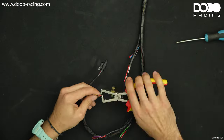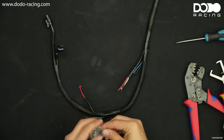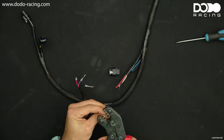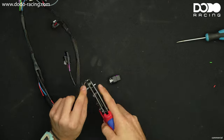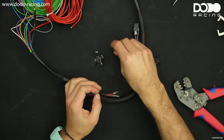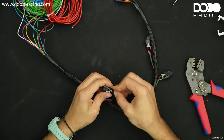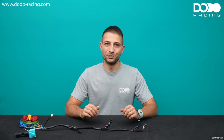All that's left to do now is wire the other five connectors. You can also add some heat shrink, but I like my wires just a little bit exposed — this way I can easily recognize the color code afterwards and it's just a little easier when you want to wire your ECU. Also, if you are running wasted spark I would still recommend pulling all six trigger wires to your ECU. Maybe you want to upgrade later to sequential, and it will be a lot easier if you have all the trigger wires available at your ECU. I hope that you enjoyed watching this video and I really hope I could take away some fear from you, because I think there's nothing more satisfying than holding such a nice piece in your hand that you've built on your own. Leave a comment below on which topic you want covered in the next video. Goodbye, see you next time!